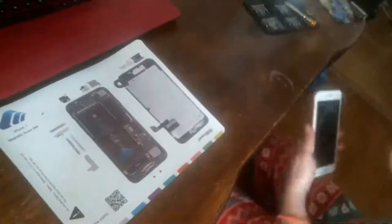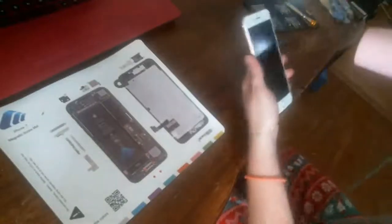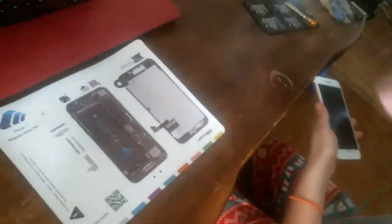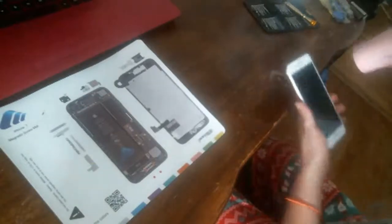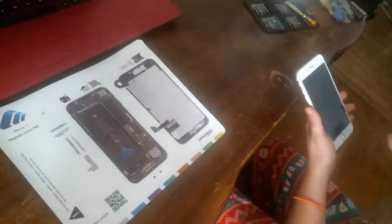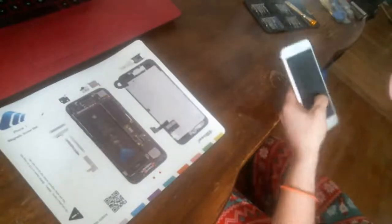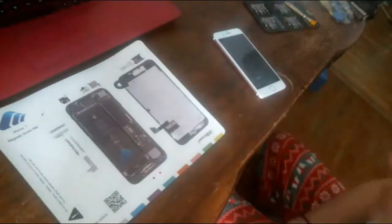Okay, sorry. So I'm heating up the front glass here. The reason I'm holding my hair dryer kind of far away is because, I mean, the LCD's bad on this one already. But if you have one with a good LCD, you can sell the broken screen, guys. I have done it, as long as they're OEM. And you don't want to create hot marks on the LCD touchscreen under the glass. So that's why I'm showing it to you like that. Sorry, it was so loud. I'm sorry.